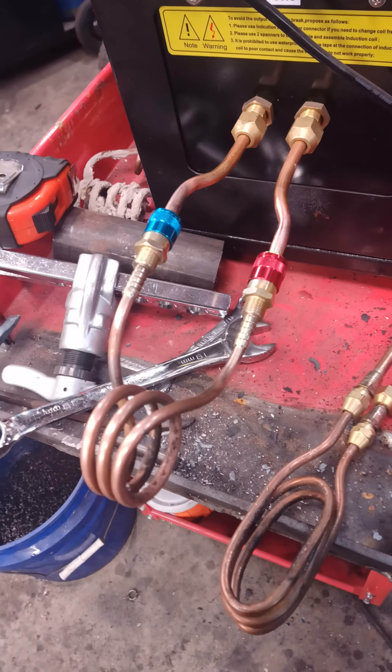It does work. I didn't see any decreases in efficiency. However, the fittings did start to heat up. I don't know if these are aluminum — I think they're anodized aluminum. I don't know if the aluminum is causing any kind of issue. There are two springs inside here and four ball bearings. These were drilled with a 15/64ths drill bit, and then the original coil that comes with the machine just slides right in there once that's drilled out. The outputs actually slide right into the original piping. If you want to try this, it's up to you. One thing I would recommend: after you're done brazing or soldering, flush them out and blow them out with an air hose so that scale doesn't accumulate in the line and work its way through the cooler. Alright guys, that's about it.